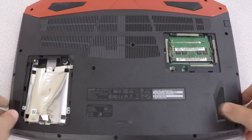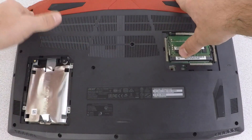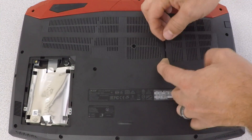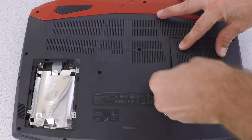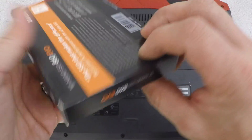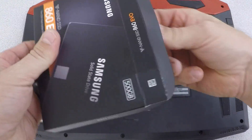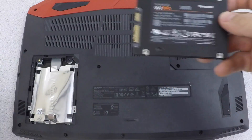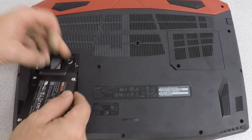The last step is to put the back plate on — push on all the edges so everything snaps together firmly and ensure everything clicks. Then put in your RAM tray so it's sealed. After that I'm going to install a 860 EVO 500GB SSD, which will give the laptop a lot more storage. I like that this laptop has an expandable storage bay that's easy to access. Then I'm going to test the thermals and see how well everything works.